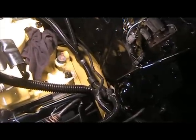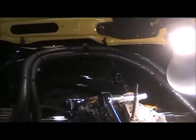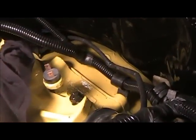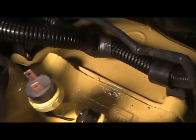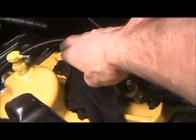Now guys, this is what I come up with back here on the wiring harness. I used a couple of the red hose clamps, squished them down so they'd fit the harness and put them on the back of the transmission bolt on the bell housing. The only one I haven't figured out how to anchor yet is the one going to the alternator. I gotta figure something out there.